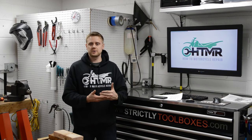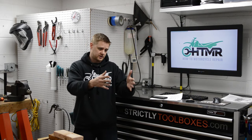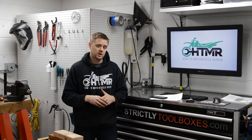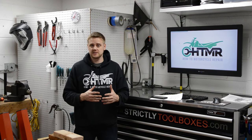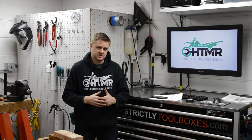In this video we're going to cover how a motorcycle transmission works. We'll go through all the parts — I have it disassembled on the bench here and we'll see how it works. A motorcycle transmission is a constant mesh, meaning the gears are always meshed together, and it's also a sequential transmission.